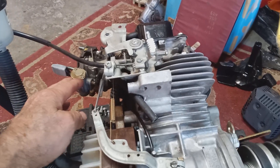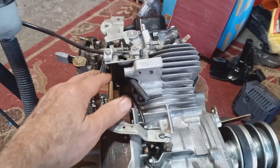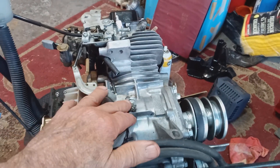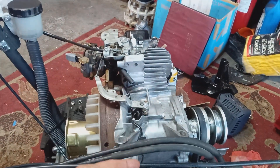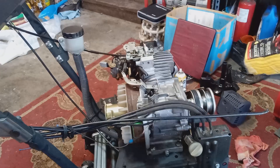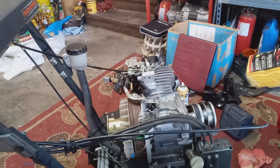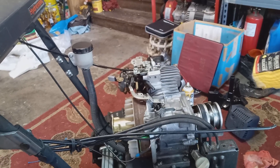I hope this helps. If you have a racing problem, don't panic — shut off the engine as soon as it starts screaming so you don't blow it up, then start investigating what you did, whether it's replacing the carburetor or getting it back from the shop. Most of the time it's the linkage. A broken governor inside the engine is extremely rare in my experience. Check out the link at the end of the video on how to adjust your choke and RPMs. We'll see you next time.